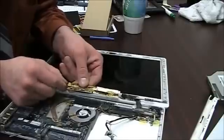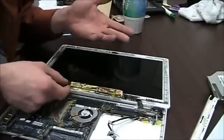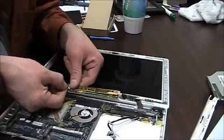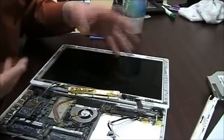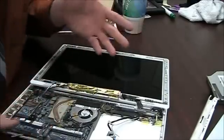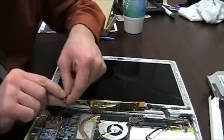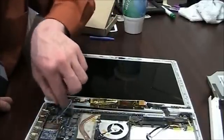You also have a black cable on the left here that hops out really easily. If you did another screen replacement and the light won't come on, it's possible you just pulled that out a little bit and it's just kind of hanging in there. That'll make it so the background light won't turn on and the LCD won't display. Follow this cable down and you'll see a little plug that connects directly into the logic board — it's real fragile so be careful.